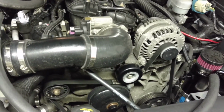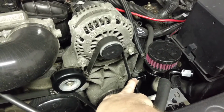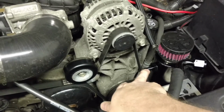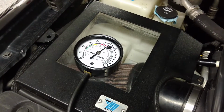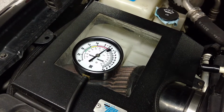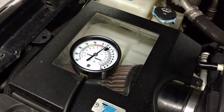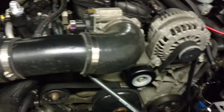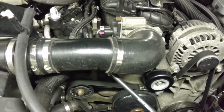left a little bit of room on the table with the last video because of this factory sized 3/8 barb that I rated around 650 horsepower conservatively. As you remember, we saw about 2.5 psi. I immediately started getting some concerns about cracking pressure, and do people say, oh, is this too much? Because we really want none. I even said that in the video, but I was throwing a whole air compressor worth of air at it, so we got 2.5. It didn't hurt the engine. Obviously it's still running fine.